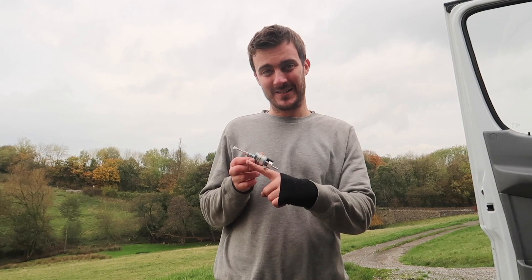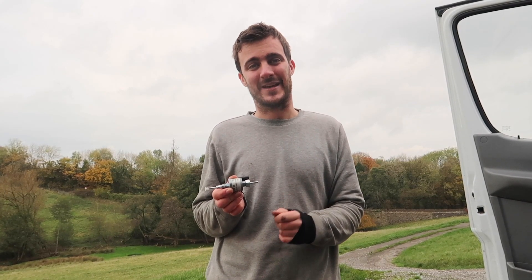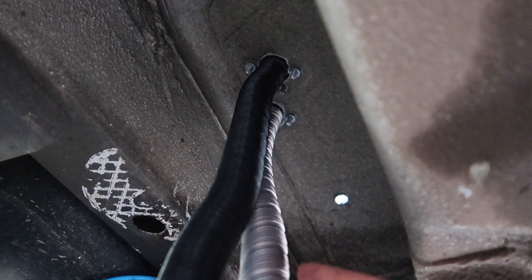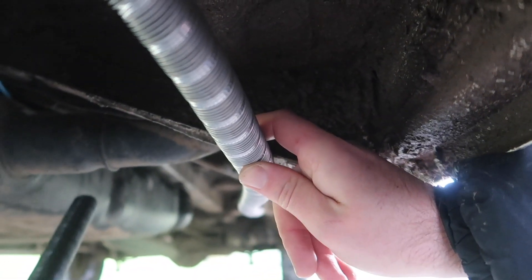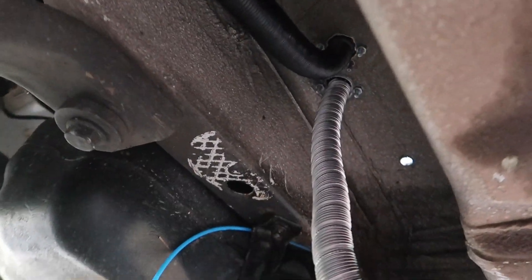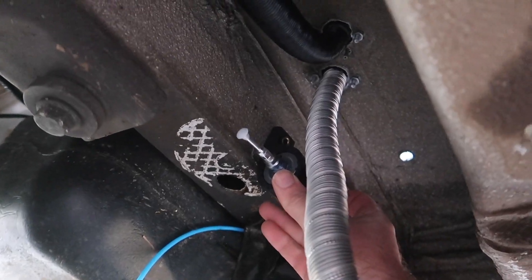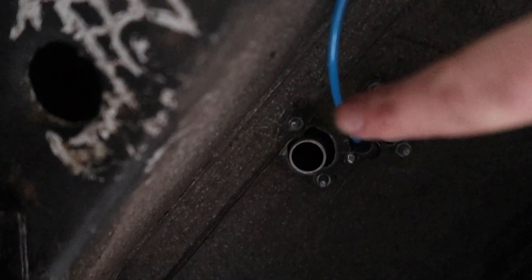The most important thing with the fuel pump is to mount it on a 15 to 35 degree angle. Different brands have different amounts of angle required so check your user manual. Make sure you check which way around the pump goes. So underneath the vehicle I'll put the intake and exhaust on. The exhaust is the silver one — I'm seeing where would be a good place for it to go. The air intake I'm thinking I might run toward the front of the vehicle, and I think here might be a good place for the fuel pump to be mounted. So this is the fuel system done — it comes out from the tank, runs to the fuel pump and then loops around and goes into the fuel inlet.